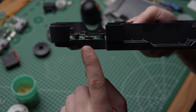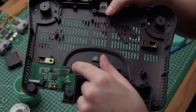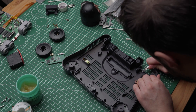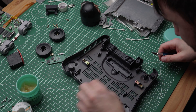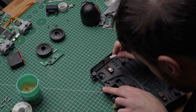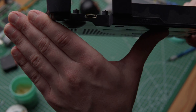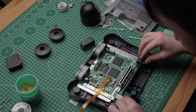We still need to prepare the bottom shell for the HDMI board. We need to make a cutout right here and also cut down that screw post a little. Take your time cutting for a clean result — it is better to shave off little by little than all at once. Please note that the process can look different depending on what console revision or region you have. Once happy with the result, get the motherboard back in and connect the ribbon cable to the HDMI board.